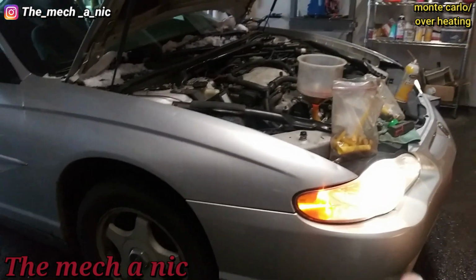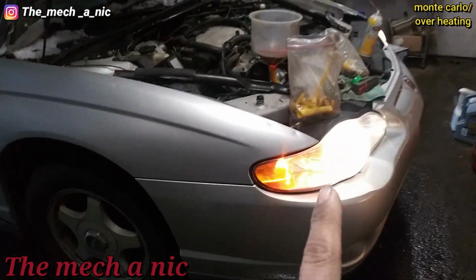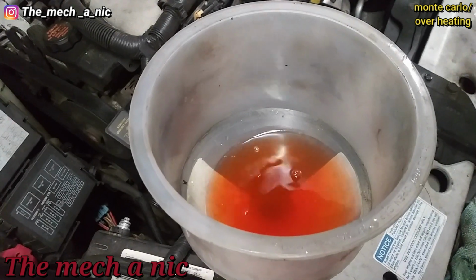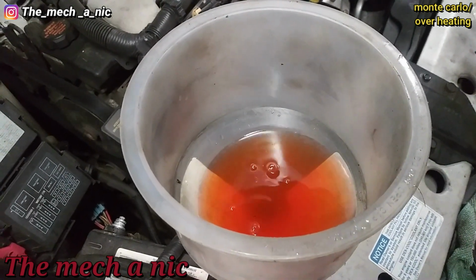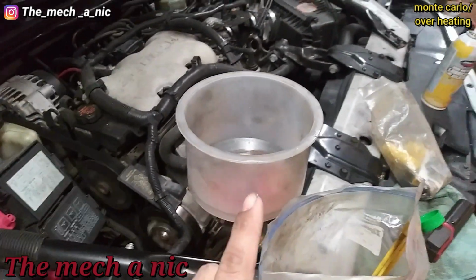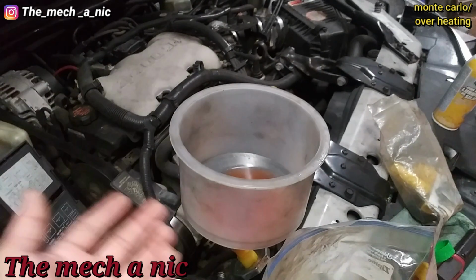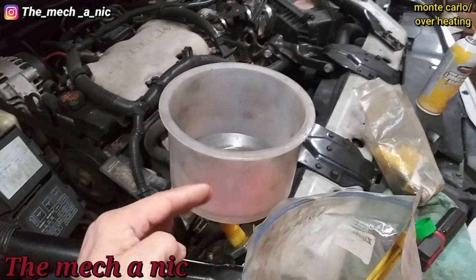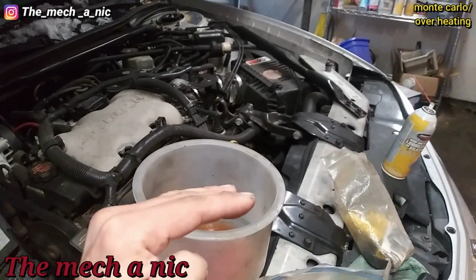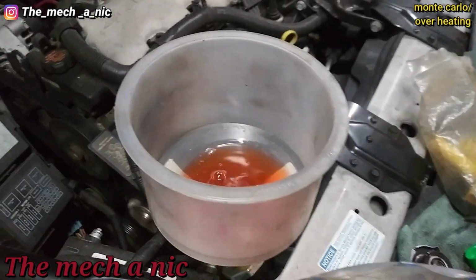Anyway, I checked my timer because I set a timer since I turned on the car. It's been 5 minutes, okay? And look at this. It is still doing that after 5 minutes. Now here's the thing with air pockets. If there's an air pocket in the system and the bubbles are coming up and it's releasing the air, well, usually that fluid level is going to keep dropping because the fluid takes up the space of where we had air pockets, right? But that's not the case here.